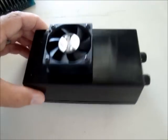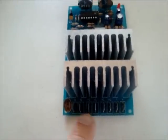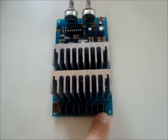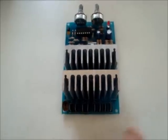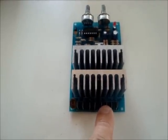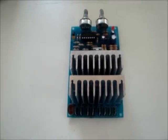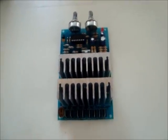If you open the box of the 30 amps PWM, this is what you see: you have two posts for ground, two for minus for the cell, two for plus for the cell, and two plus for the battery. You hook it up exactly the same — from the relay of the battery, or battery fuse relay, then you go here to plus, then you take the plus L to go to the cell, then you take minus L to go to the minus pole of the cell, and then you take the ground post and connect that to the minus of the battery.